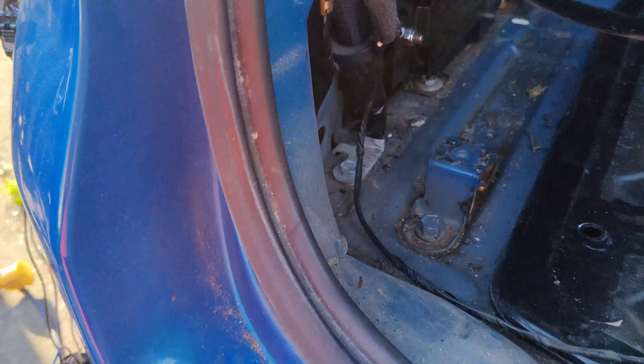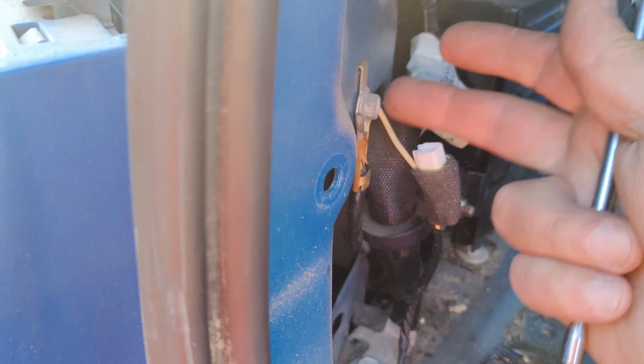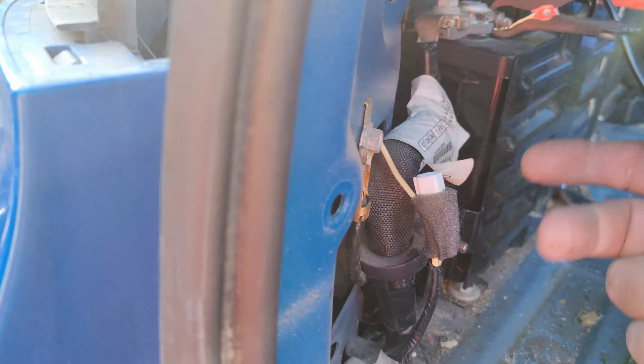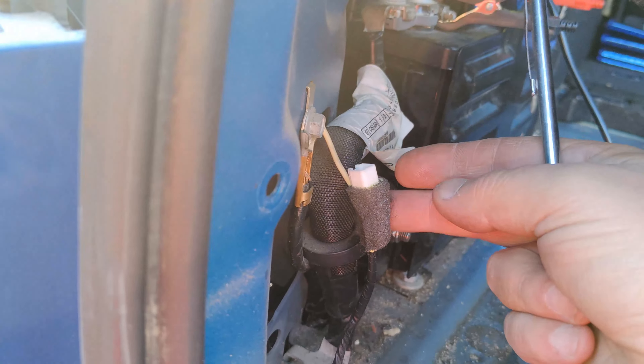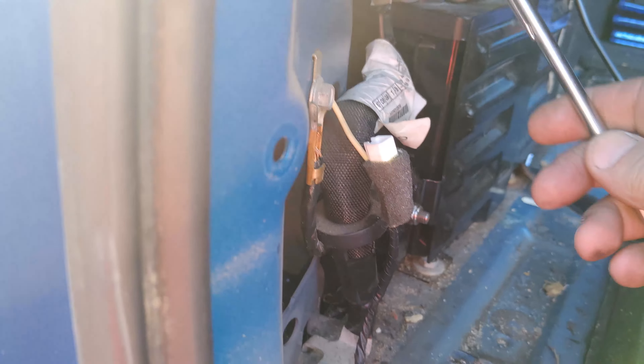I'm able to get to here — this is where the grey wire ends. The earth is obviously going to the body there, which is great, but the grey wire joins to nothing. So I'm kind of bummed out there. I was hoping it would be a connection that was unplugged or not connected properly or something, but anyway, I've found something else.